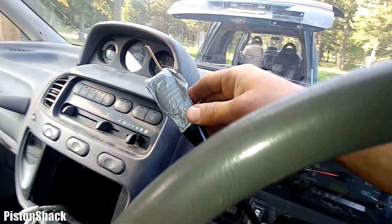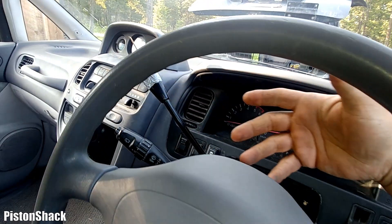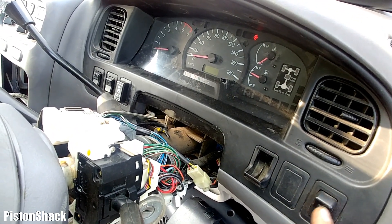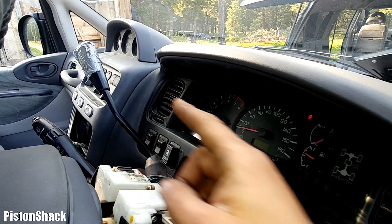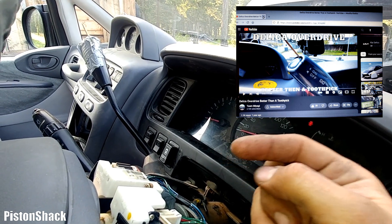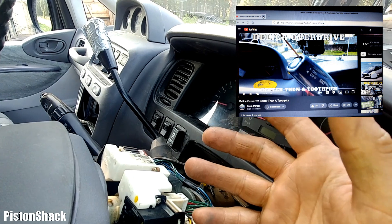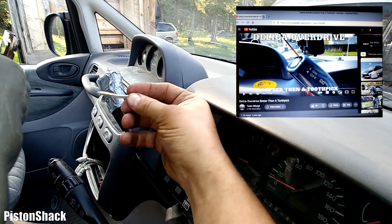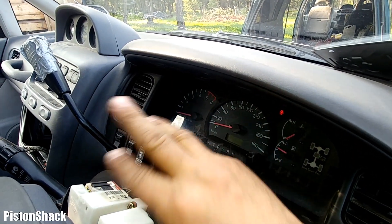If you don't have a replacement part — you don't have the switch in a shifter handle — there's always a solution. You can install a regular switch, like a simple light switch, using the same principle and same wiring, just for overdrive control. There's a great video on YouTube from a channel called Team Miyagi — M-I-Y-A-G-I — called 'Delica Overdrive Better Than a Toothpick.' I'll put a link in the description. He explains everything in detail: how to wire it, how to install it, very basic, three wires.